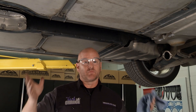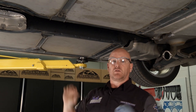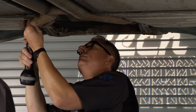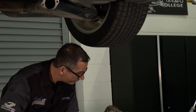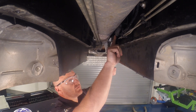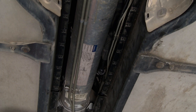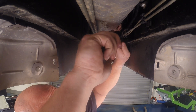Thank goodness for a lift for this repair. You can see the anchor points — the pucks that John talked about, right from Corvette engineering. Totally safe, totally up in the air. Our first step was to remove the central part of the exhaust system — 14 to 16 bolts, a couple guys with cordless guns, two minutes and it was off. Next, we removed the torque tube cover — 36 eight-millimeter bolts, not terribly hard, just a little time consuming. Two guys, two cordless guns made easy work of that.